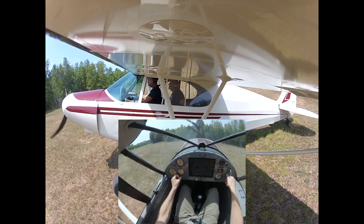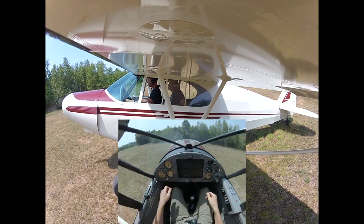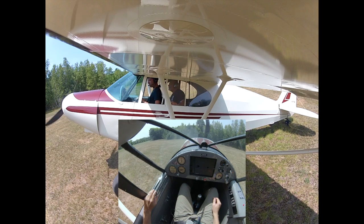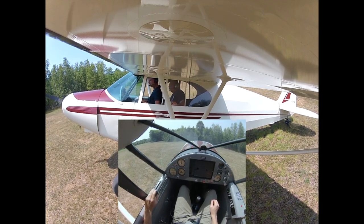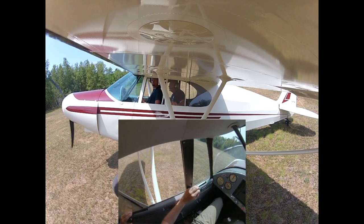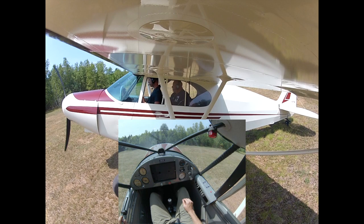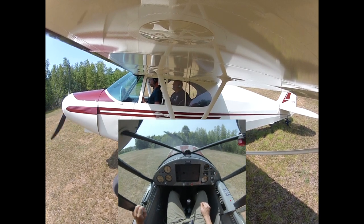I'm going to remember to pull the correct, there you go. Yep. Full idle check. Good, good. We run the engines down to like 600 RPMs on purpose when we rig the throttles, because when we're at final, we don't want any pull. Yeah. But we should idle the airplane at around 800 RPMs.